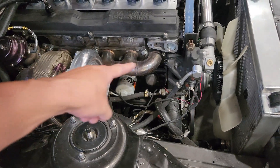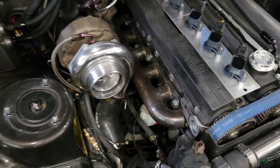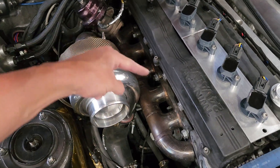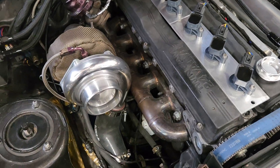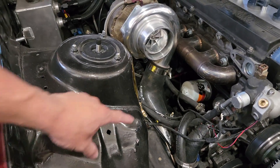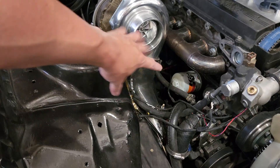For right now this works great. I bought all the items minus the flange from Treadstone Performance — I tag them in a lot on Instagram and they're awesome. Check them out at treadstoneperformance.com — I'll put a link in the description. That's where I got all the weld-els: the 90s and the 45s. That's how I put the whole log manifold together — it's TIG welded. It's pretty basic: 1, 2, 3, 4 Ts linked together, welded to the flange, and you're done.